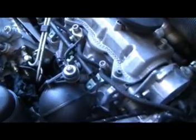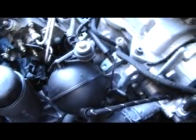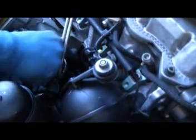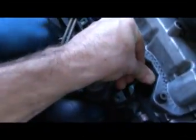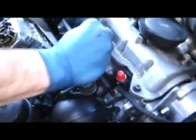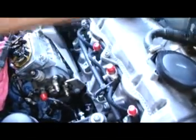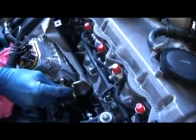So one thing we can do also to keep stuff from getting in the pump is put the red caps. If your O-ring kit comes with red caps, you can just cover the outlet ports of the injector pump. Let me get this other line off. I'm going to stick these caps on here. These are a little small for the top, but they just kind of slide down. It'll just maybe help keep some extra dust out of the injectors. You can pull those off later with a pair of pliers and slide right off. They fit better on these down here.